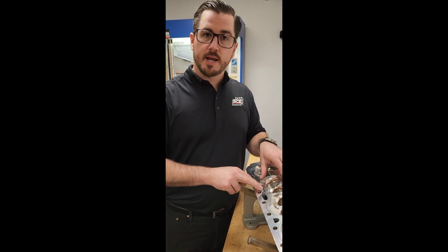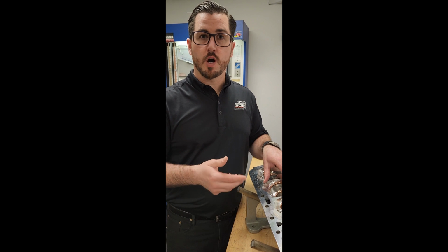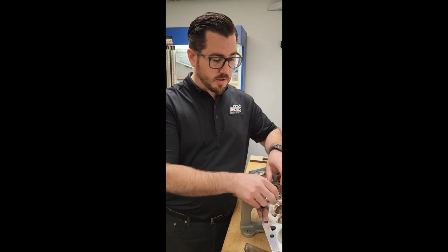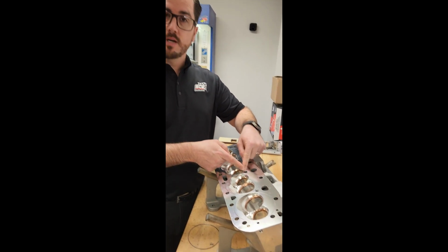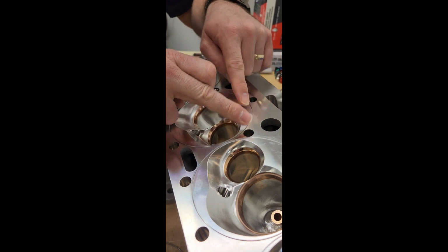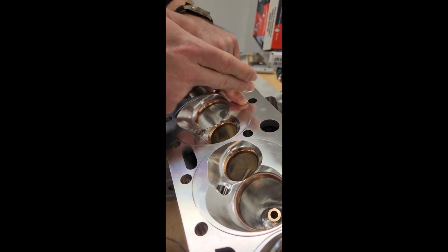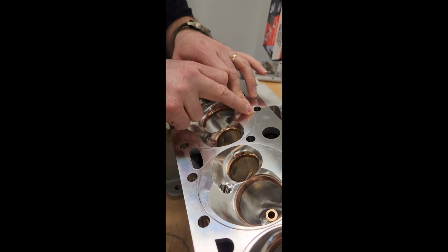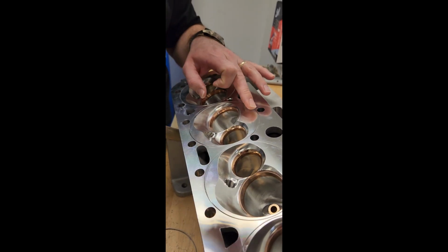So with our copper head gaskets, typically you've got to O-ring them with the Pro Copper, with the Titan, and traditionally you'd have a stainless annealed wire that you're going to be tapping in. You'd trim it to size, located near a bolt hole, then you're going to file fit that thing and butt it together. Well, that's great. Oops, I file fit it too much. Now I've got a gap. Rip it out, do it again.